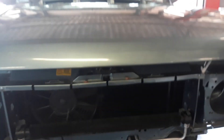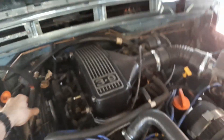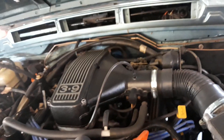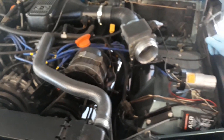We've got a new radiator and a transmission cooler. Under the bonnet, it's actually a four litre cross-bolted engine - same capacity as a 3.9, just a slightly stronger bottom end. Hot wire fuel injected, as this would have been - it's a 1992/93 vehicle from memory. Holly's built this engine up, all new brake lines running on the checked-over and repaired bulkhead. One of the biggest repairs was behind where those brake pipes are. As you can see it all looks sort of factory - really nice job in there. We've just got a few wires to sort out and get the engine running, that's kind of our next step. It's coming along really nicely - that's today's workshop update, we'll do the same again next week.